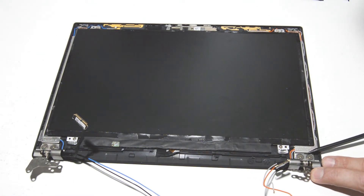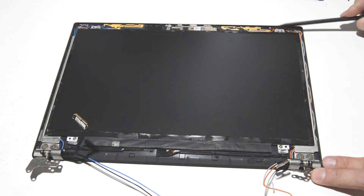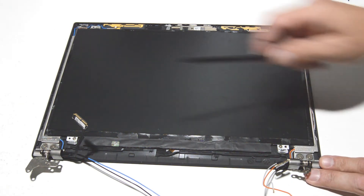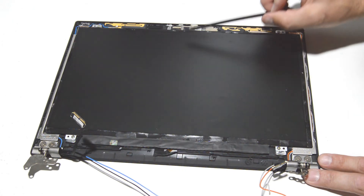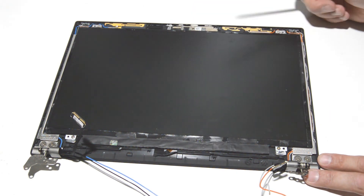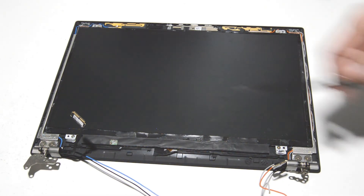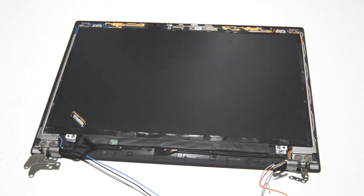It looks like just a couple screws for the hinge, and the hinge rail is also connected at the top of the LCD. Once you have the four screws out, you can flip the LCD panel up and detach the video cable to remove the LCD, or just undo the hinges to replace the hinges themselves. The video cable also runs under the LCD up to the webcam — if you want to replace the webcam cable you'll have to remove the LCD to do so, same with the Wi-Fi antennas. It's just a few screws to remove the components, and most are held on by a little bit of tape, so it's really easy to work on.